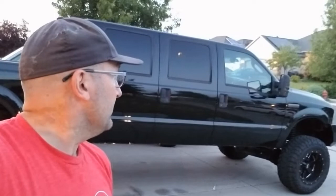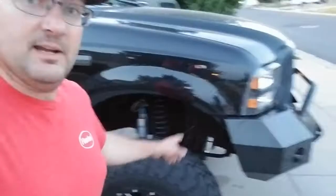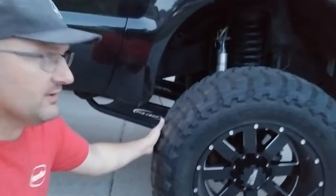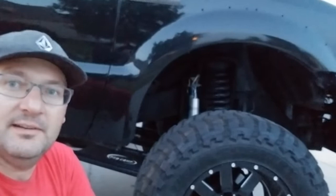There are a bunch of little details still to do. I still have to splice the headliner. The very rear body mount bolts — I haven't got those put in yet because I need the bottom body mount bushings that are threaded and I don't have those. So right now I'm running with six body mounts instead of eight — not the end of the world, but I'd feel a lot more comfortable with them all on there. I was also missing one of the bed mount bolts, so I've got seven instead of eight. I'll get that put on too pretty soon. I also have to put the fender flares on the front, but I've been putting that off because they're from an F550 — they hang down and they'll get chewed up by the tires, so I've got to cut them off. I've just been driving the truck around enjoying it with holes in the fenders.